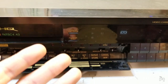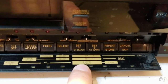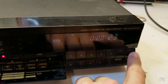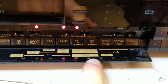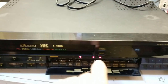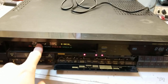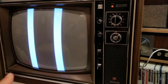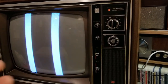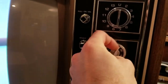Different countries have different channel number-to-frequency assignments. What this VCR does is give you a wide range where you tune, similar to older North American sets. These channels are presets — you set your preset and search up and down, checking the switch on the back for the correct standard for your country, then manually tune in your channels. I don't have any analog PAL channels, but I want to see if this will output an NTSC tape to an NTSC TV. There's the test signal — just two vertical bars, tuning in somewhere in the high 20s.